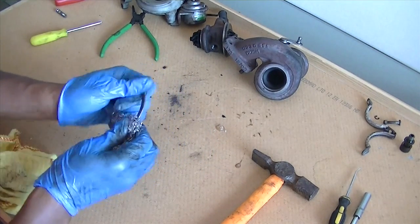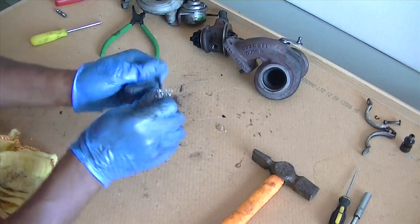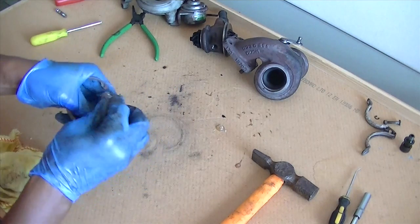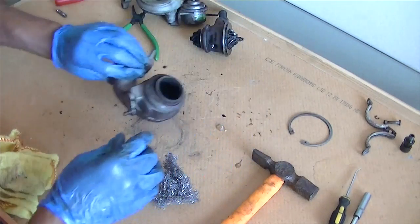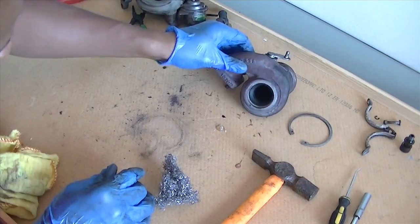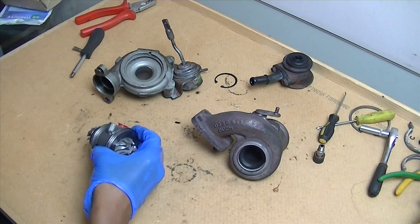It's very important to get this done - don't delay it if you start to see the symptoms. What I always do is clean up the snap ring because it builds up a bit of corrosion, so just use a wire brush and clean it up so when you come to putting it in it's going to be a whole lot easier. Really simple stuff - just good maintenance.